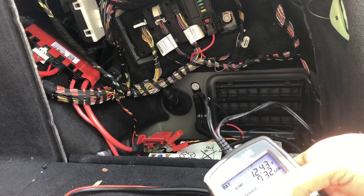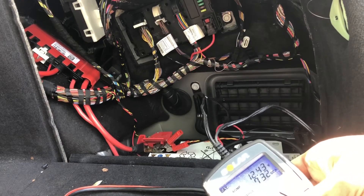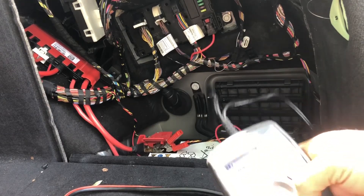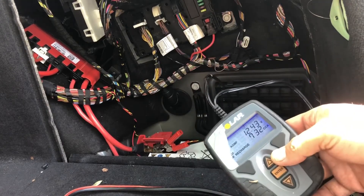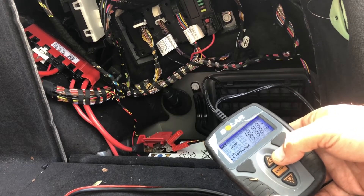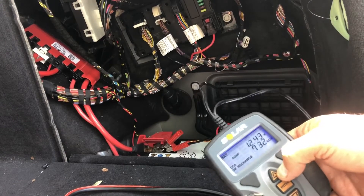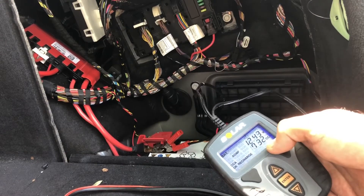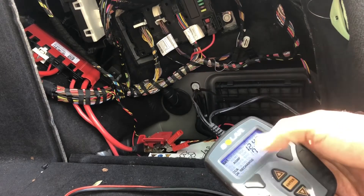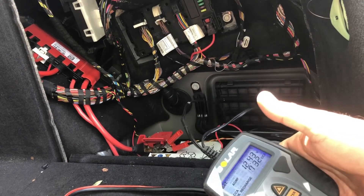732 indicates it's probably like 60-70%. So that's what this tool does — you can buy it anywhere. It shows you quickly how good your battery is. It says 'recharge' because it's not 900 CCA. What it does is it briefly short-circuits the battery, checks the voltage drop, and from that it basically knows how good the battery is.